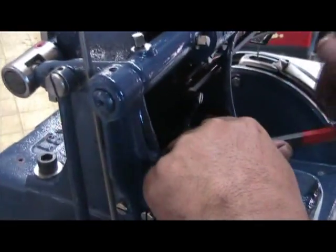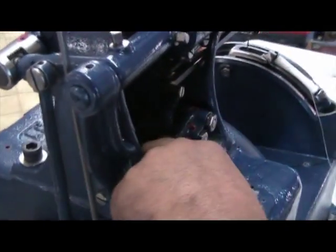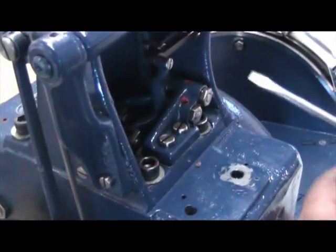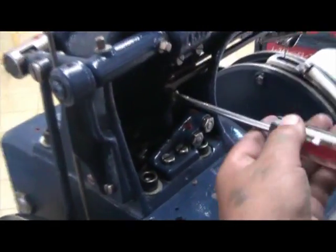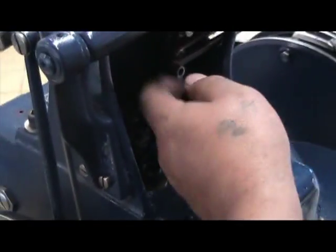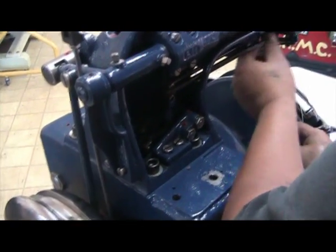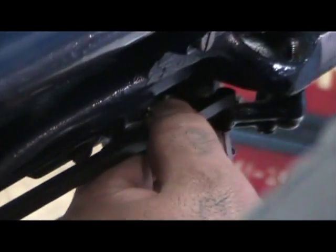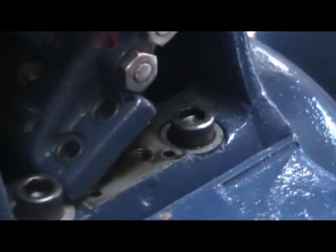The only way you're going to damage this adjustment is by putting the machine through a serious bind. It can also happen in moving if you grab the head and try to lift the machine with it — there's enough weight to wiggle things out of alignment. You can try to get to that bottom screw without full removal, but it's better to go ahead and loosen your linkage so you can pull the bell crank out and get full access. Now that you've removed the top linkages, it allows you to lift that bell crank out of the way and you can go ahead and loosen that screw.